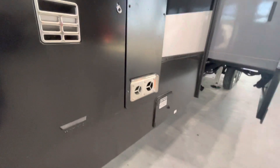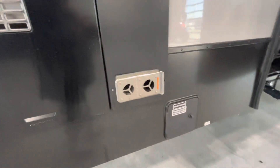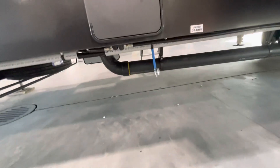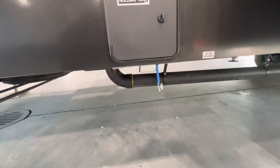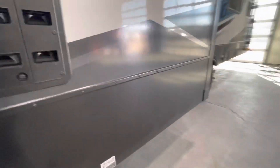Notice this one has a TV package that comes with some additional TVs. Keep the little ones away from the furnace exhaust — it does have a tendency to get hot. You do have low points located underneath here — those are that silver nozzle. When it's vertical, that means it's draining the tank; when you turn it crosswise, it'll shut it off. Your discharge for your septic is located right there.